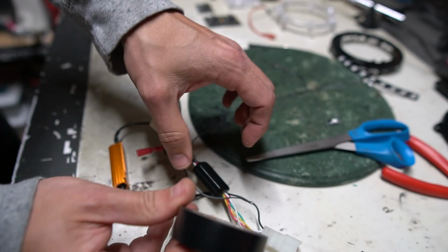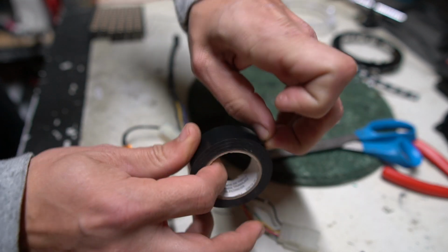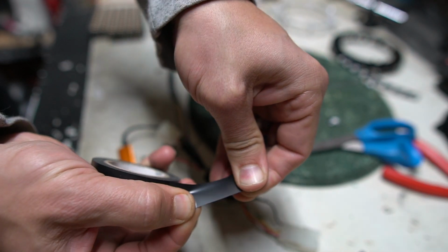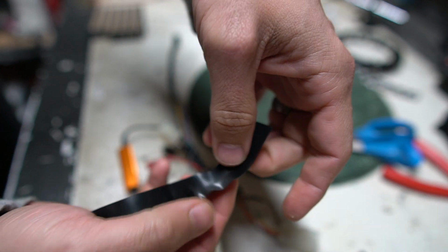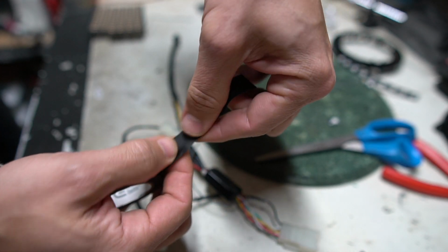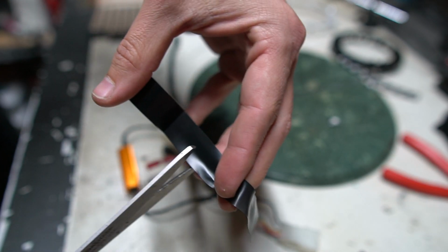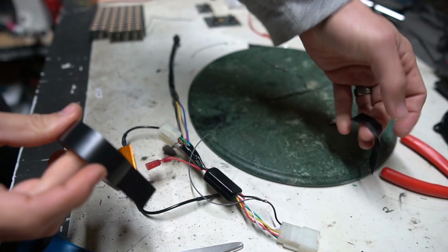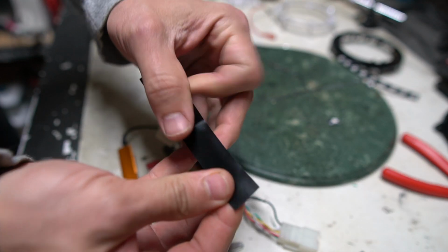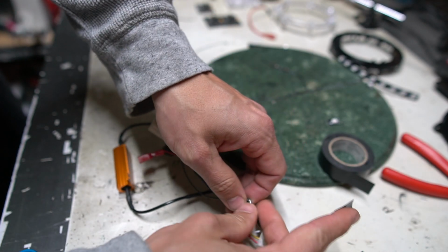And then one other big piece of advice is you don't want to just tear this stuff by hand. I see people do that all the time, because if I just stretch this thing all out, when it gets heated up later, that weird stretched out section is going to respond to that heat, and that's not any good. We don't want the tape to fail later. So make a good clean cut mark. It's also going to make it easier if you ever have to find that cut mark and open this tape up. Just cut a little piece, don't ball it up all giant and huge.